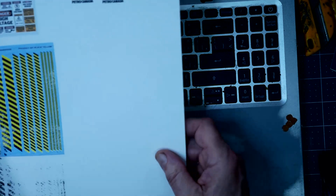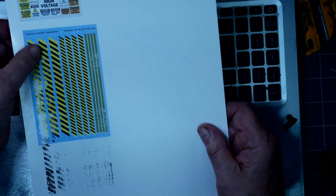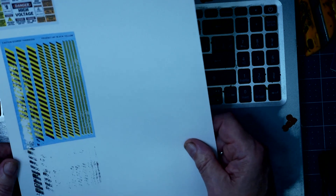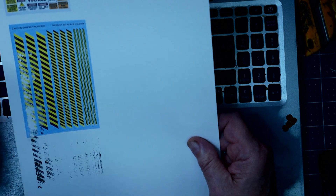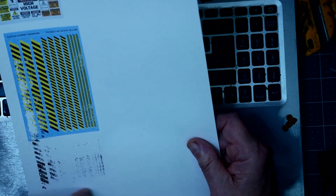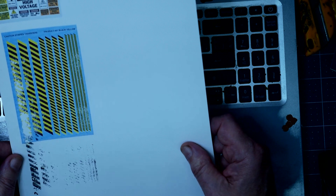I printed the white one immediately after printing the clear one. And obviously some of the ink from the clear one got on a drum or something and transferred to this one. What I would suggest is you can buy cleaning paper for your laser printer. Print one sheet, let it set for a bit, put the cleaning paper through twice as recommended, and then print the next one so that this doesn't happen. But because these are yellow and black with no white anywhere in them, I'm going to use them on the clear, not the white.